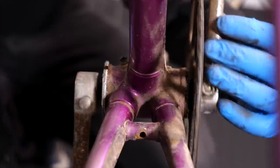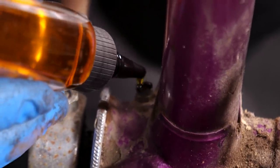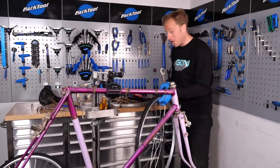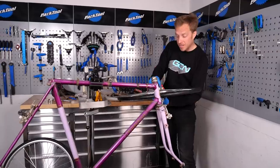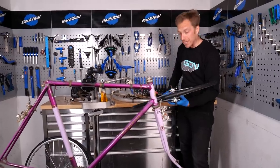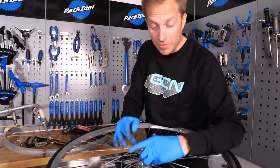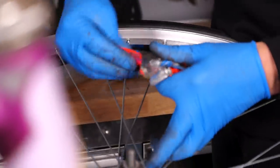Silky smooth already. When I was a kid, one of my mates had a bike with a little port like this - this one's obviously lost its top cap; it used to come with a little steel cap or a little cork. Time to put on the 18-tooth freewheel. We've already got a 16-tooth fitted; the new wheel came fitted with an 18-tooth, but it was a fixed one - that would be absolutely savage to send Si off riding on one of those without telling him. I'm going to need an old lock ring spanner. It wasn't even done up because the fixed sprocket tightens itself whilst you pedal along.